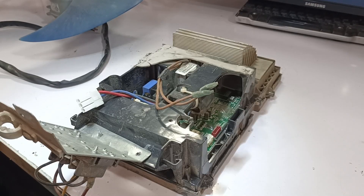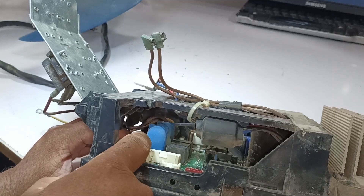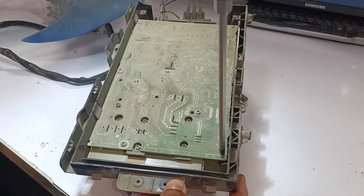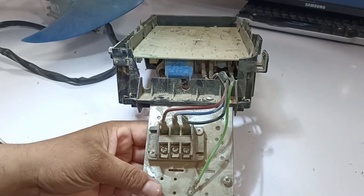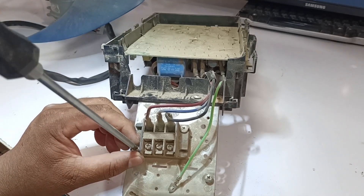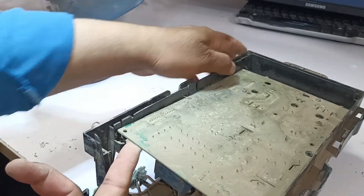To test the blower motor, the first step is to remove this blue capacitor from the circuit board. Testing with another capacitor might not clearly indicate where the fault is. Let's start by removing the screws on the sides. There's also a large screw here. Now that we've removed those, we'll also take out this screw to completely disconnect the PCB from here. I'll press the locks to get the PCB out.